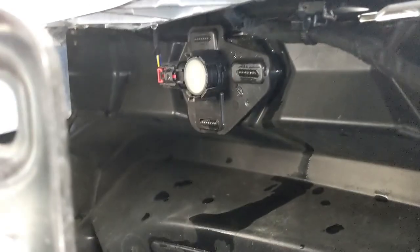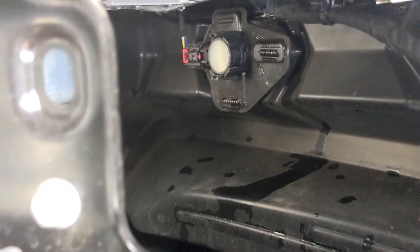As near as I can tell, the water is not coming from the frame rail — this looks completely dry up here. There is some water staining coming through the front bumper, so I think the front bumper grill and maybe around some of these sensors still leaks a little bit.